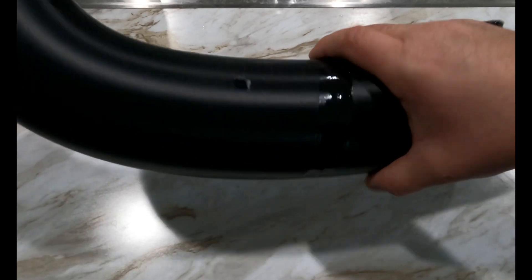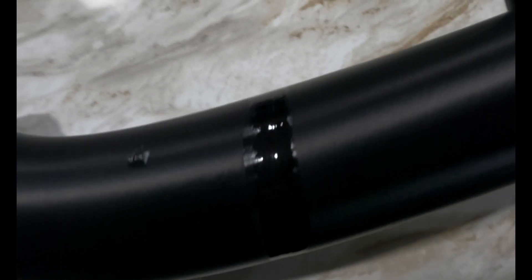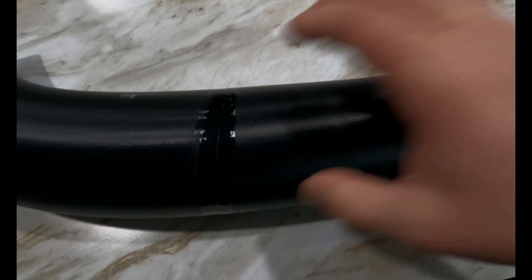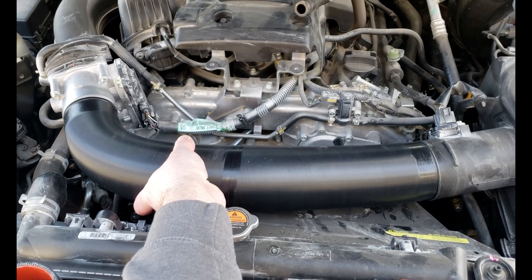This is the finished product. I got carried away because I poured more acetone than I needed, so I ended up painting the inside and outside of both ends, as well as the breather port — and that actually started to drip. The seam isn't super pretty but it seems to be holding up really well. I'm going to give it a little more time to dry and cure all the way through, and then go test it on the truck.